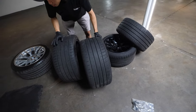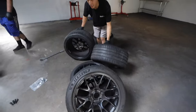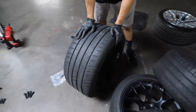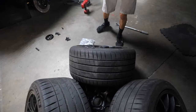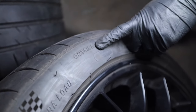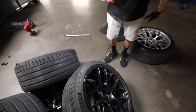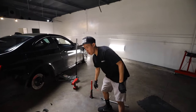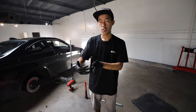There's directional tread — that's another thing to explain. Certain tires are directional. Fortunately, these are Pilot 4S's — they are not directional, they're just inside and out. How we know is it's going to say right here: inside, outside. If you ever get your tires mounted anywhere, make sure it's mounted properly. If it says inside on the outside, it's incorrect. Certain tires are rotational — meaning they only spin one way, can only go on one side, cannot be flipped, and it'll be labeled on the tire.